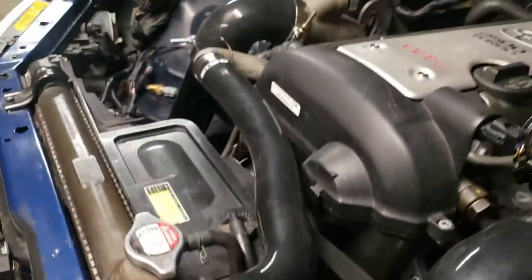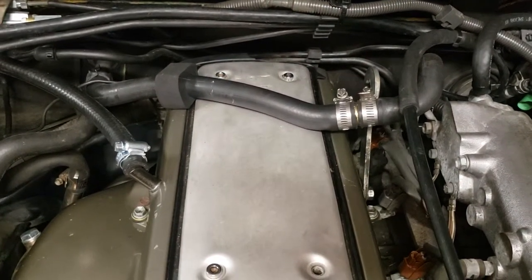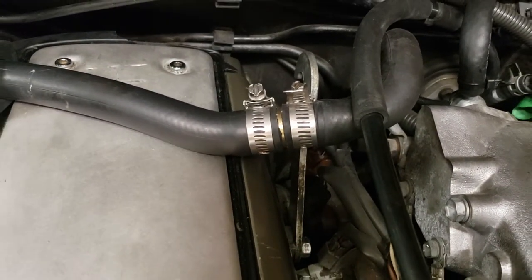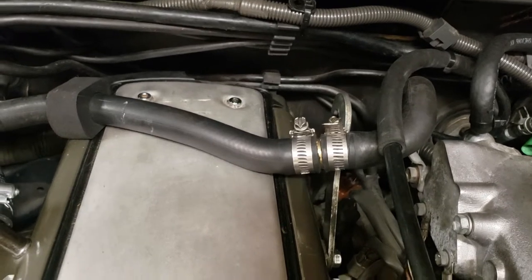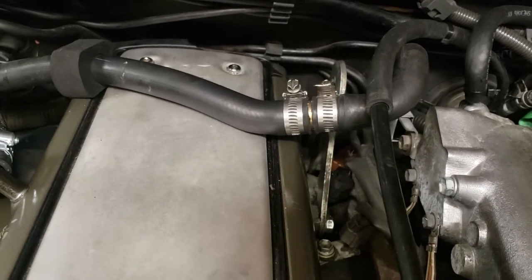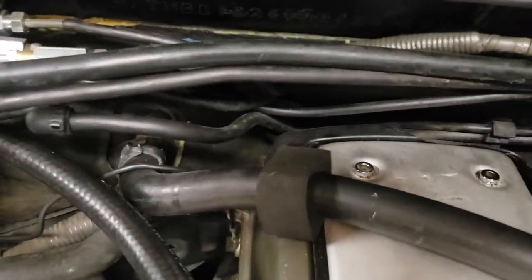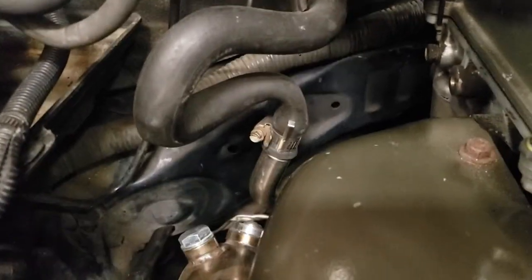The bends don't crash into anything — it's almost like it was meant to be. For the rear heater hoses, I reused the IS and the 1J hose and threw a coupler push fitting in there — I believe it's either three-quarter or seven-eighths inch; pull a tape measure on the inner diameter to confirm. If your hose is long enough to reach, just leave it attached and plug it right in. My importer had cut it really short, so I had to work around that.